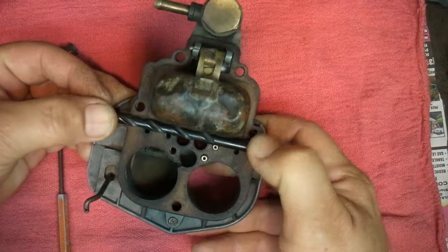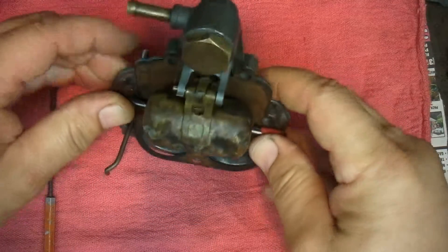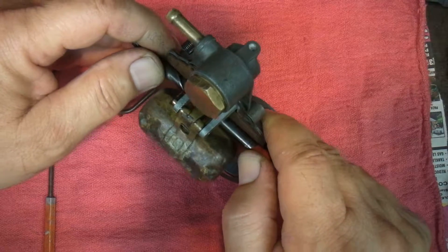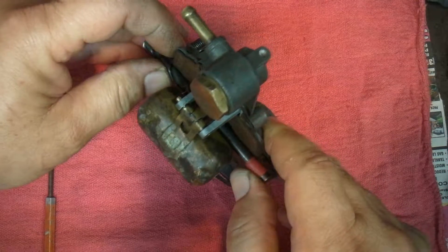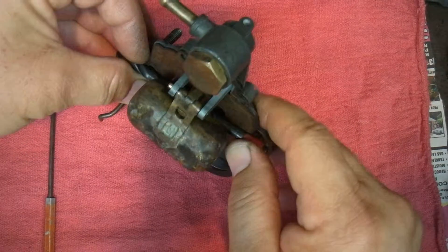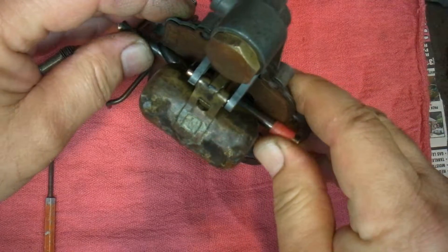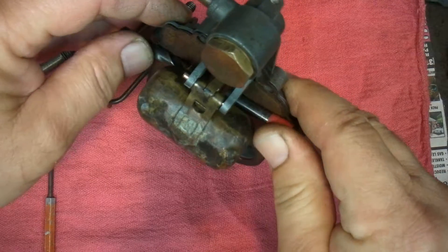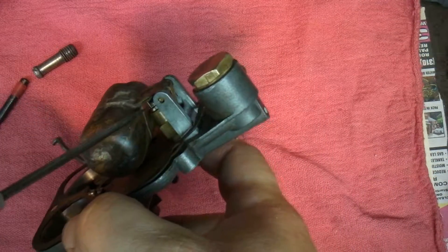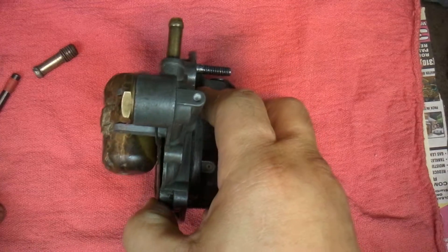What you're supposed to do is put the drill here and put some pressure — you can tell I'm putting pressure on my thumbs. What I do is roll it underneath the float and see what kind of clearance. Like this one — you can tell the float is real close, it's too low, but this is just a demo. What you'd want to do is just have that drill bit just touch the bottom of the float in this vertical position, to keep that little ball on top of the needle from squishing down. Once you get your six millimeters, you're done.